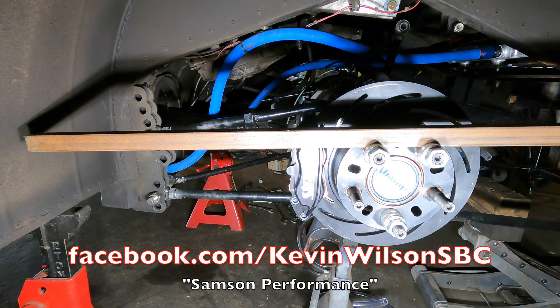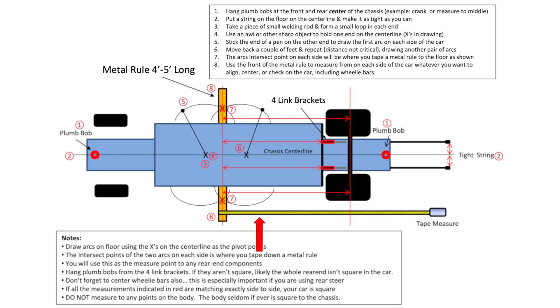I see a lot of people — in one of my Facebook videos a couple of weeks ago I was measuring from the four-link bracket to the rear end, which was a quick and dirty method for me because I know my four-link brackets are basically squared to the metal rule. You can measure from the metal rule to each side of your axle center line. If you don't do this and you just assume your four-link brackets are square to the center line, and you start trying to center your rear end based on those brackets or by equalizing the four-link bar lengths, but your brackets are not actually square, you are now introducing rear steer into your car.